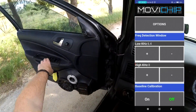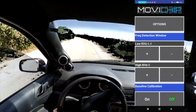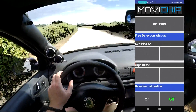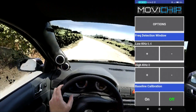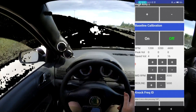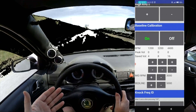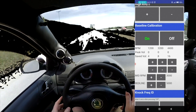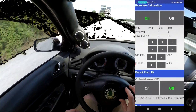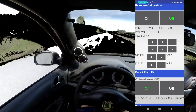What you can hear in the background is the actual sound from the knock sensor. When we do this run we definitely do not want the engine to be knocking at all — otherwise that's not going to give us an accurate baseline reading. Get it down to around 1,500 RPM and I'm going to roll into it in second gear. Just press on gently and it's now registering. I'm going to roll into it gently — not full throttle, just gradually get more and more into it. 6,000 RPM, press off, preferably before we lift off the throttle. That's given us 3, 11 and 15.